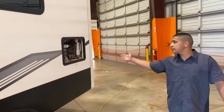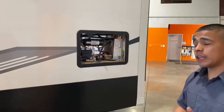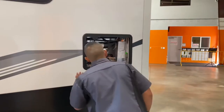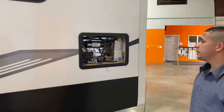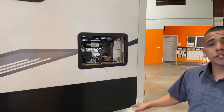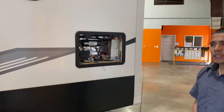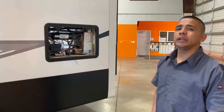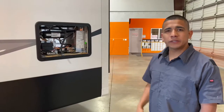Right over here is the outside of your fridge. Your fridge has an automatic setting so it will work off of electricity or gas — right now it's on propane, so we know that's working well and it should be cold. You don't have to do much here besides service: make sure it's clean from debris, dust free. If you have issues with bugs, you can screen it, but just make sure it stays clean.